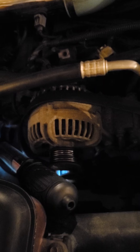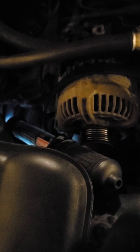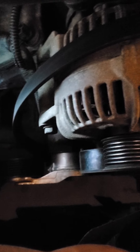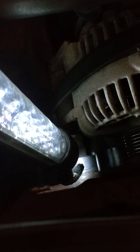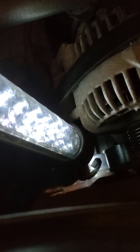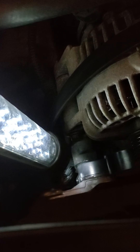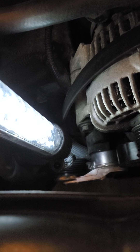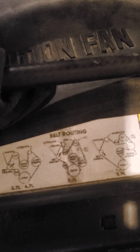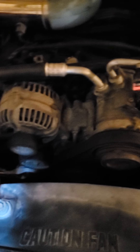I've switched to the new part — I don't have the belt on yet but I've got the new part seated. You can see there's not a hole for the top prong on this side; on the right side it just sits on top of the metal and prevents the piece from spinning while keeping tension on the belt. Before putting the belt back on, refer to your routing diagram, which for this particular truck is located right on the hood.